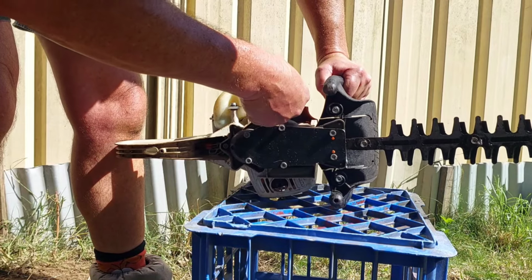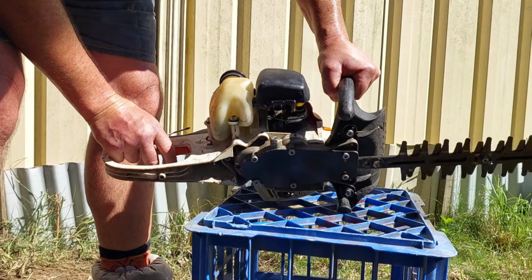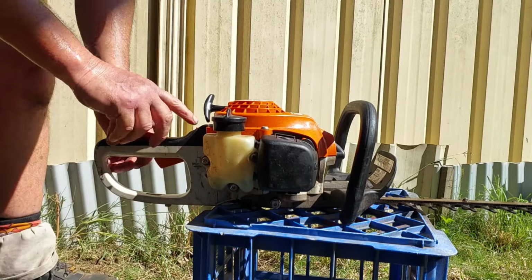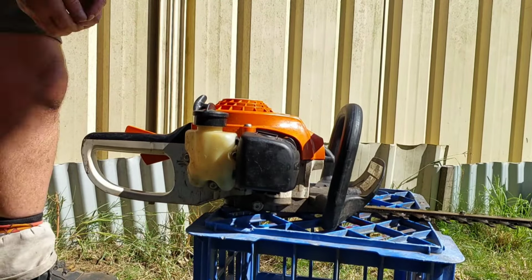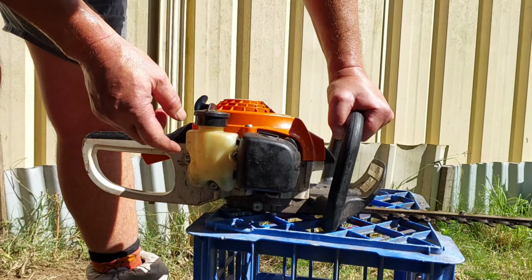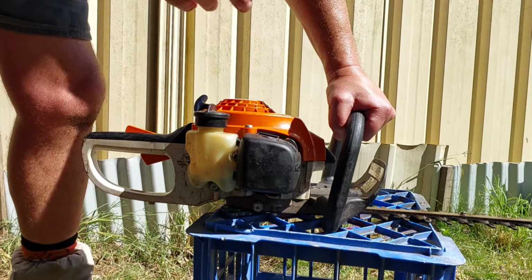That was before. Then let's just start it again. There, I've leaned the low out just a tiny bit, and I've leaned the high out just a tiny bit too. So she's running a bit leaner, but she's still four-stroking and she's idling properly. The higher revs are not good for these things. They sort of have a load when they cut. But apart from that, she's going, so I'll give these back to the guy who owns them.